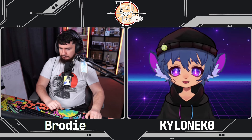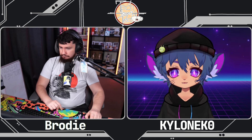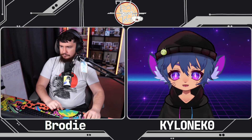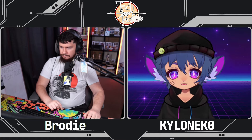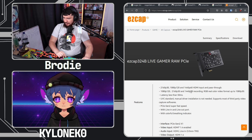The only caveat is you have to go through QPW Graph and link the audio to your system audio - that's the only thing. Other than that it'll just work. I do notice with my EVGA XR1 that if I want to use it via audio I have to unplug it and plug it back in to refresh it, but other than that it's not really an issue with the PCI Express card - it just works.